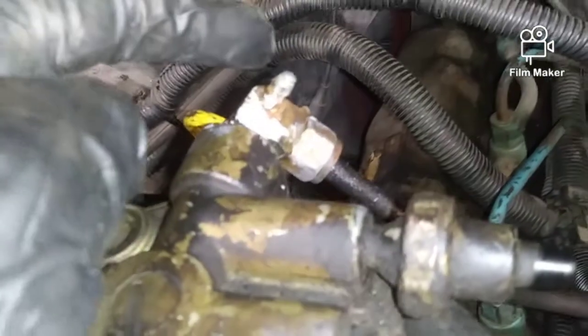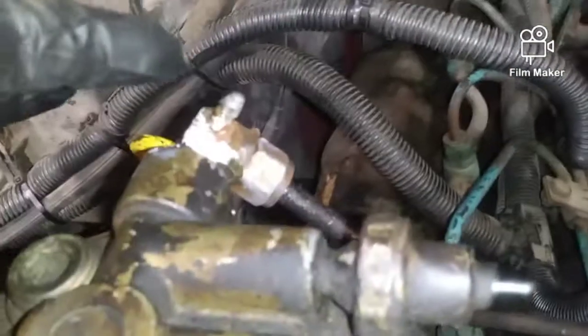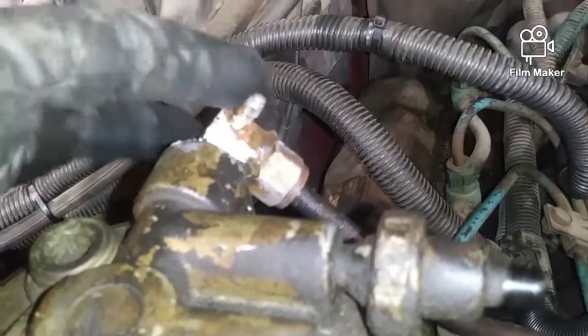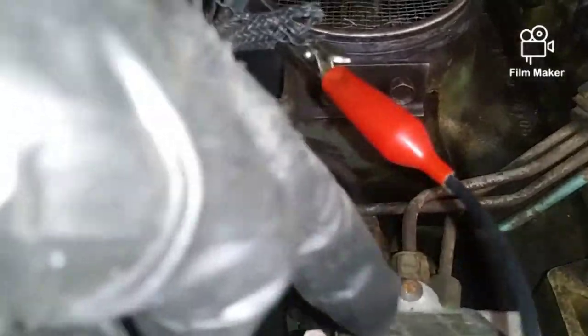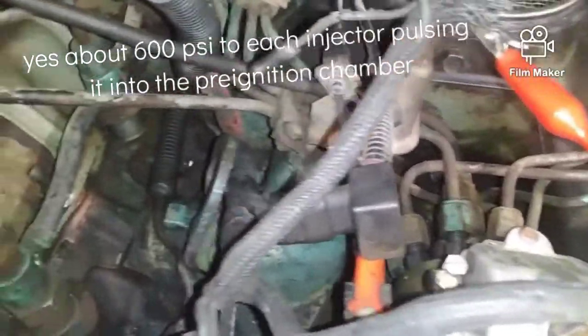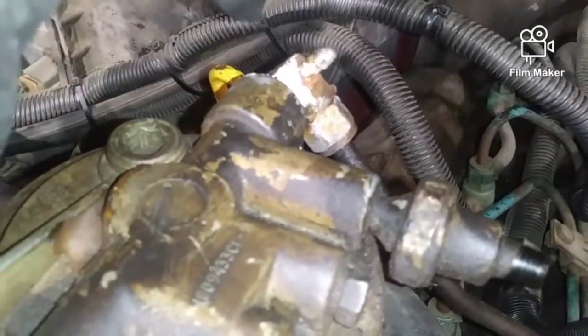You should not have this little nipple. I actually just soldered this lead into the hole like you would in plumbing, and you just use some flux, salt, and lead solder, that is, not for wires. There's many different kinds of solders. This is your outlet, and it goes to about 5 to 8 psi, give or take, only, and it goes down to your injection pump, and then the injection pump steps it up to several hundreds psi, 5 to 800 if I'm not mistaken. Alright, that's a different video. I'm going to stop describing that. That's just a compression fitting. So that's the outlet.